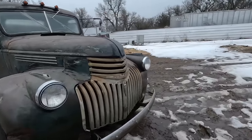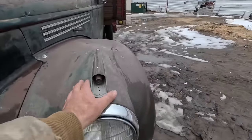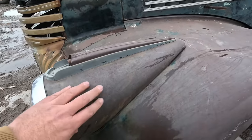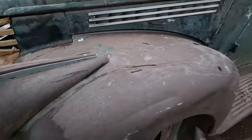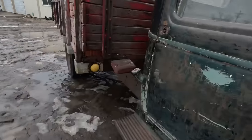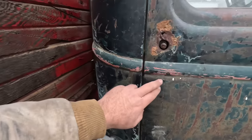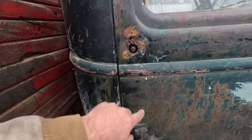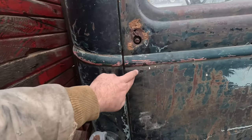There we are — another 1941, and this one has a title. Here are those pot metal lights I was talking about earlier that the other '41 should have had. This part's the same on them — this part's a Pontiac piece. One other thing I forgot to mention: the difference between a '41 and a '45 and up is the key. The key for the passenger door on the '41 is in the handle, whereas on the '45 and up it's right here on the door.